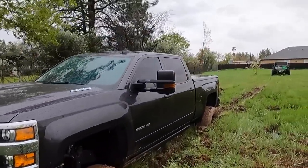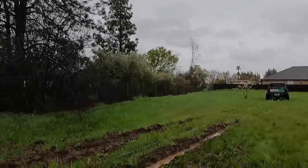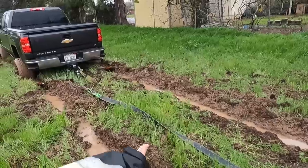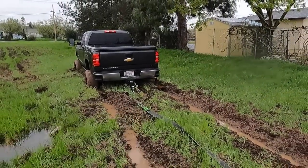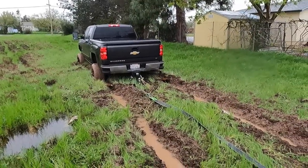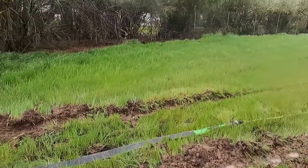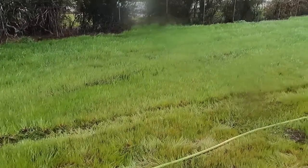This is how we got it set up. We're going to go right for the kinetic rope — bump it two or three times and see if that moves. On this end we're not hooked up to that ball hitch. We have a bridle going underneath it, so that is a four-inch by ten-foot Rhino USA tree saver. It's rated for a break strength of just over 40,000 pounds, and then we have that paired with a 30-foot kinetic rope.